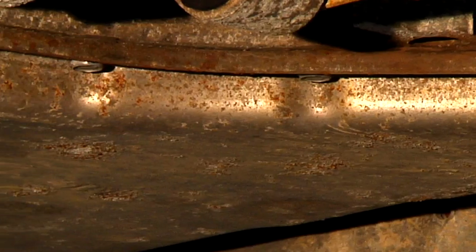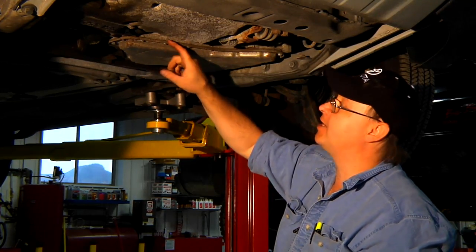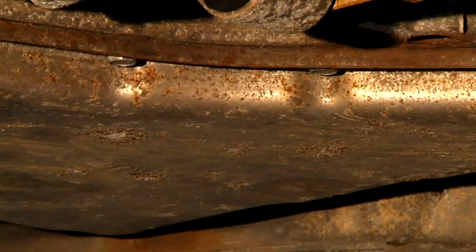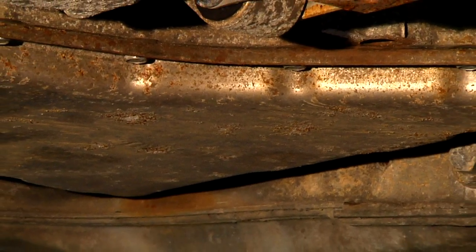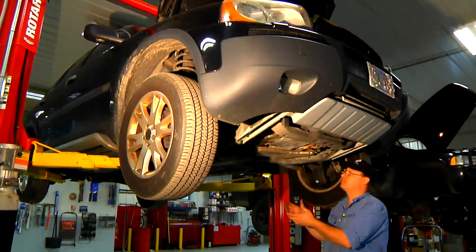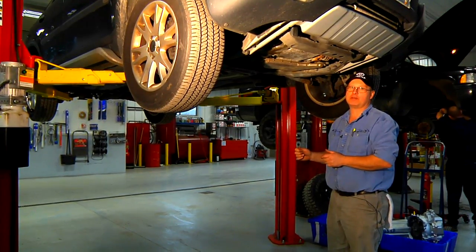You want to check for the specific torque reference for these bolts. If you tighten them too much, it will destroy the gasket and your transmission pan will leak. Now that we have our pan installed, we're going to have to go up top and refill this transmission with transmission fluid. So these are some tips on how to change your transmission pan. I'm Bob Holcomb from Apex Automotive in Great Barrington, Massachusetts.